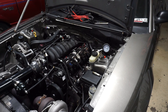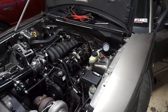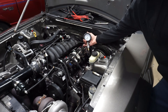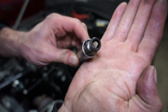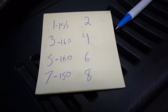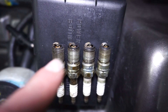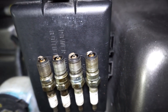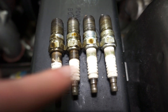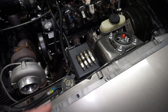We have 150 on number seven. The tip of the plug looks okay but it's all wet around the threads on the back side. Driver's side is done — got 155, 160, 160, 150, so that looks pretty decent. Here's what the plugs looked like on cylinders one, three, five, and seven. You can see all the threads were covered in oil and these are actually a little bit burnt on the outside. Good thing we caught that. I did already order new plugs for it, so we'll be good there.